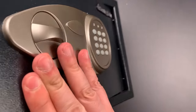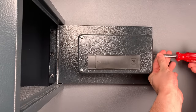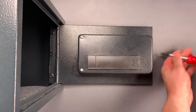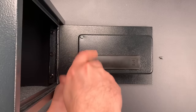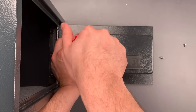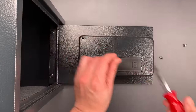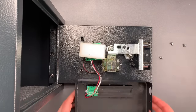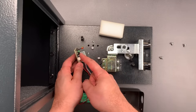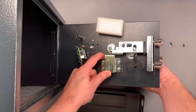Let's turn this around and I'll show you exactly what's going on inside the safe. We have three screws to take the back of this door off. Here we have our high-security sponge. You can see that green LED that I pushed out of the way. All I did was reach through this hole and push down on this solenoid, which allows the bolts to retract.